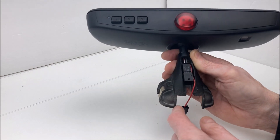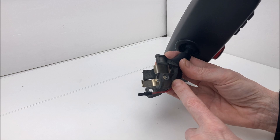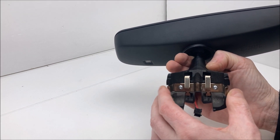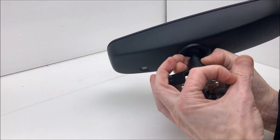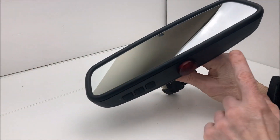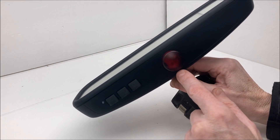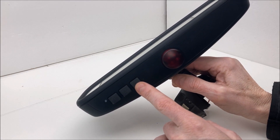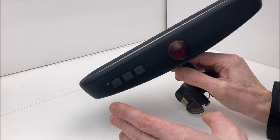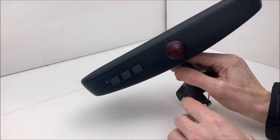I also had to run an additional wire for the alarm LED because it needs a constant 12-volt power. The bracket that came out of the CC mirror was basically the same as the EOS bracket, as long as it was designed for a rain sensor — cars without rain sensors have a different, smaller mounting base. I also stripped out most of the original internals: this mirror normally only comes with one LED, but I built a little plug that goes into the cap and mounted four LEDs in there.